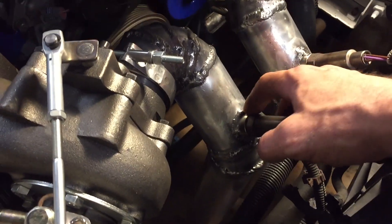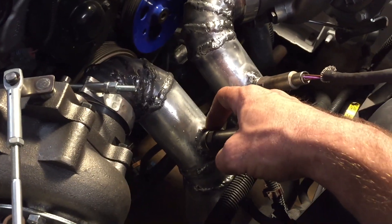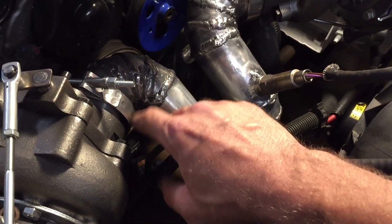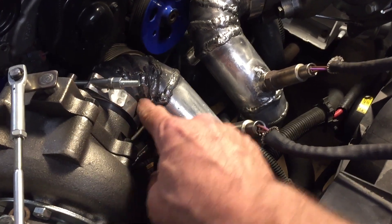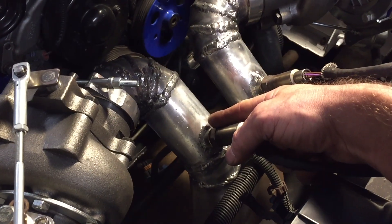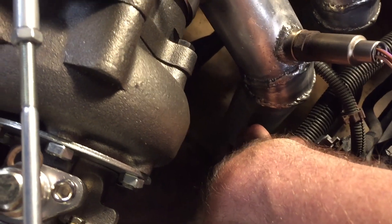The whole reason for grabbing these O2 wires was I wasn't sure if I had to put the old O2 sensors back in alongside the wideband sensors, but I'm pretty sure I need the original factory O2 sensors in there too. When I put these bungs in yesterday for the wideband, I started reading the directions for the kit and it says to place them six inches away from the exhaust outlet on the turbo. Mine are only about three to three-and-a-half inches away. So the plan is to put the stock O2 sensors close to the turbo and install the wideband sensors further down the pipe.